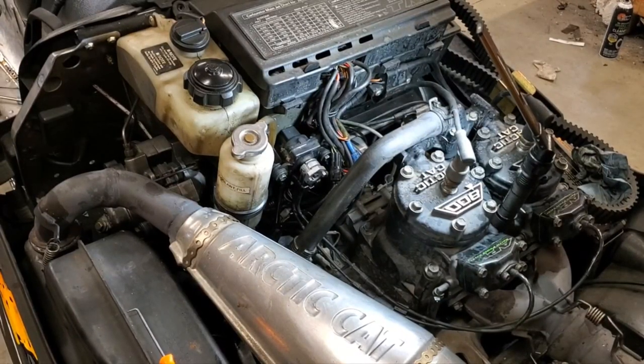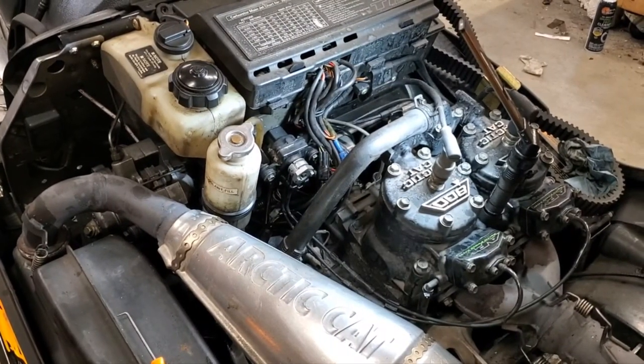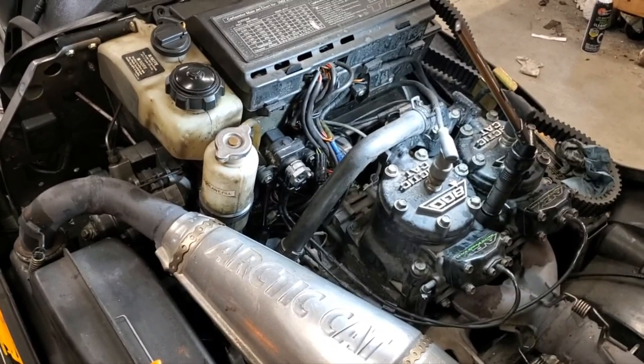All right. I've got my track up all the way off the ground. Yes, I do not have my slides in there, but in this situation, it shouldn't much matter because the slides aren't actually going to be in contact with the track. And I'm not going to do this for very long, just long enough to see if those power valves are firing. So we'll go ahead and key on,